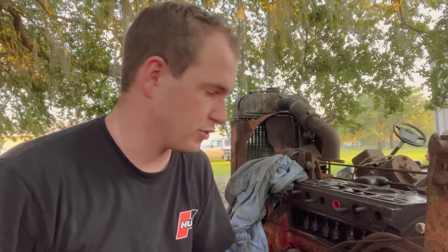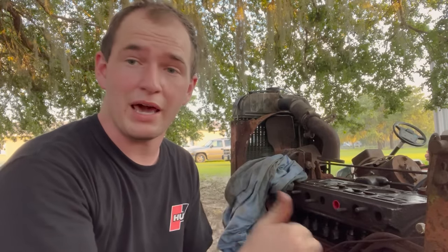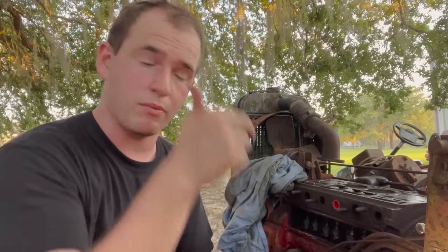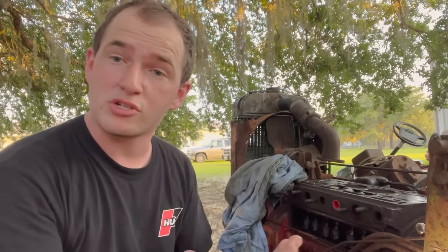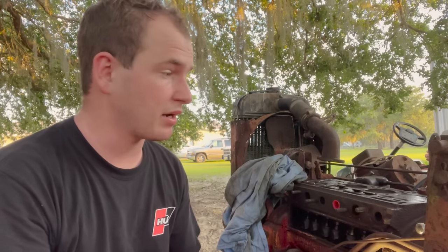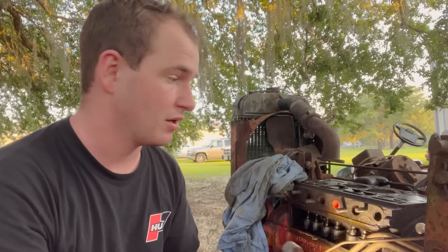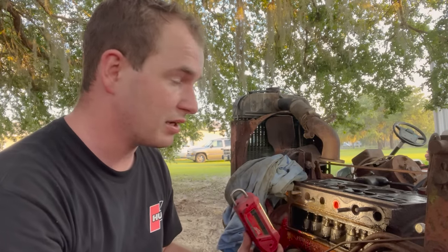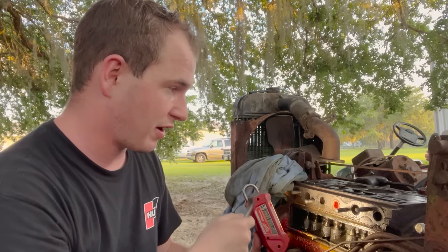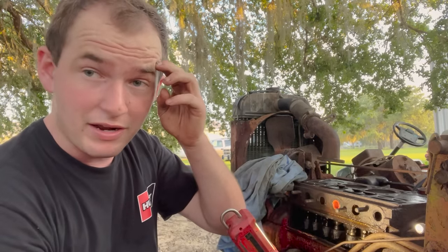So the one time we were trying to move this valve, work it, break it loose, we finally hammered it down. We got it all the way down and we're like, okay, sweet. Now the motor will bump it up. We'll hammer it down, bump it up, and slowly it will become free. Well, that didn't happen. It just got really stuck and it was enough where the starter couldn't push it up. So with enough soaking and heating, eventually we got it where it would barely slide up with us turning the fan, someone tapping the cylinder down and everything, and it finally popped back up.